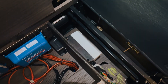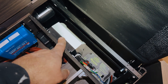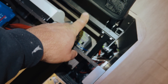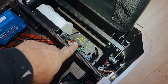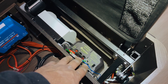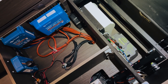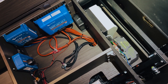The MultiPlus is wired into the consumer unit just here — this is one of the better areas to work on as far as consumer units go because it's quite accessible; sometimes they're put in really difficult-to-reach places. We've also left the Nord Electronica B2B in here. Our experience is that these work fine alongside the Orion XS, so this will effectively give you a true 50 amps of charge while driving, even considering the fridge is using about 15 amps of that while driving.